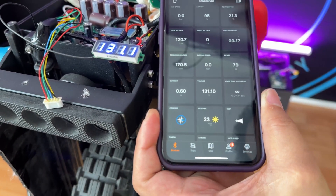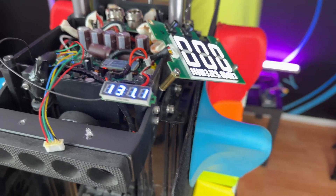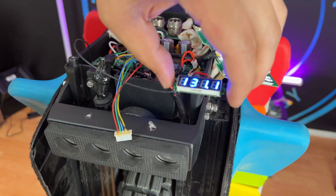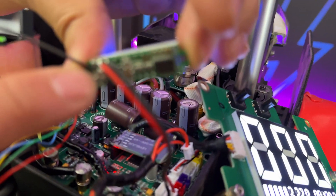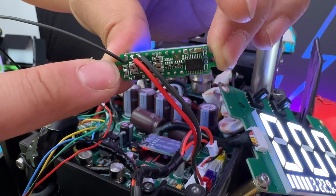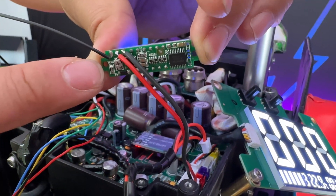In this scenario I don't need to calibrate it. These devices do come with varying calibrations, so you'll want to make sure you calibrate it properly by taking a small Phillips screwdriver on the back and turning this small set screw. Be very careful because when you turn this set screw a small amount it calibrates the voltage fairly quickly, so make sure you're turning it and looking at the display to match it with your application.